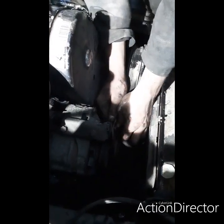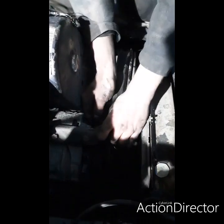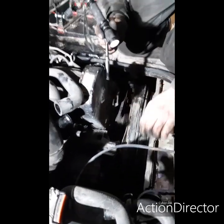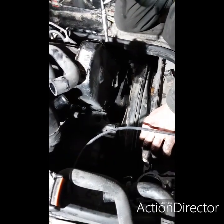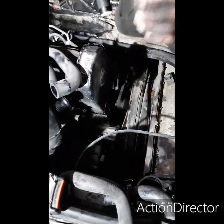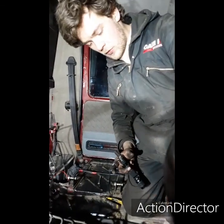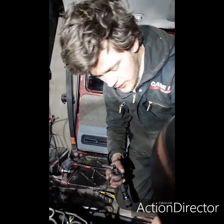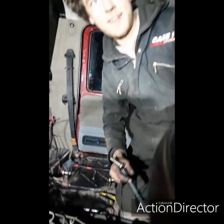There are just 13mm bolts, three of them around the fan shroud here. If I undo that and then take the metal section that cones the air in after the radiator off, it gives me that much more space to pull the engine forward and then lift it out. I've undone the three bolts around the fan shroud, so that's off now. Next there are about ten little bolts - four being 8mm and the rest being 10mm - into the radiator that hold the cone that directs air into the shroud. I undo that, it splits in half, take the bottom half out, get the plastic shroud off, then the top half off, then drop the radiator.